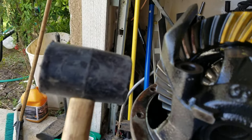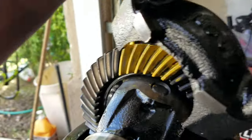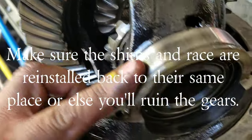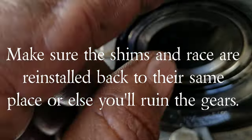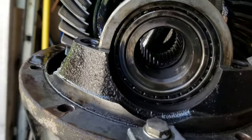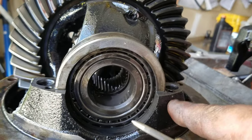What I'm doing here is using this rubber mallet and just hitting it so I can unseat the carrier. This thing came loose. If you can see here, everything looks really nice. This is the bearing right here, and this little thing right here is the shim. I need to remember which shim goes to which side. So I'm going to punch a dimple here to signify that it goes into the dimple side.